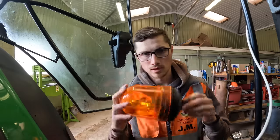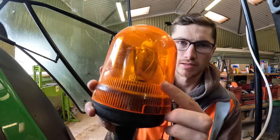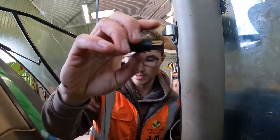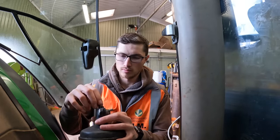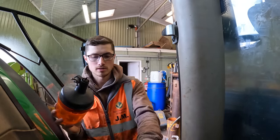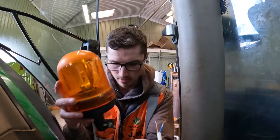I've got myself a second beacon here. I'll probably end up buying two new ones because this one doesn't actually match the other one, and also there's a big crack down there so it's really loose and needs replacing. This little thing is what the beacon will fit into — I'm going to stick that into the bottom of the beacon so you've got the little connectors on the bottom. Then I'm going to turn the light on and touch the wires — I think it's the brown wire that's live. Hopefully this will spin and flash.